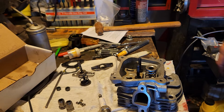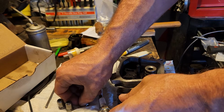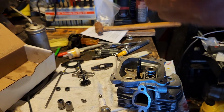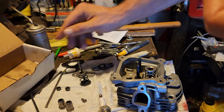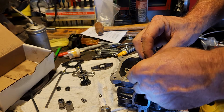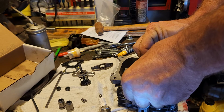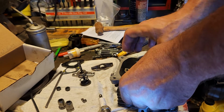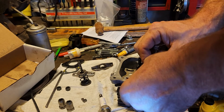Okay, I take that back, it's buried. Well, I think we can do that. If you put a little grease on these too, it can help them stick. You don't want to put nothing too heavy on them, not a lot, but it will help them stick. Just a little bit, that's all you need. Now if you were doing a 35-pound, watch I launch them through the air and into my face. 35-pound springs, you probably definitely would want a valve spring compressor tool.